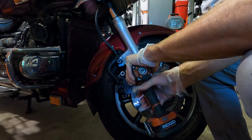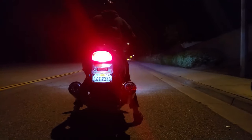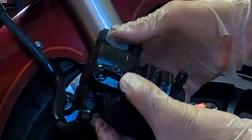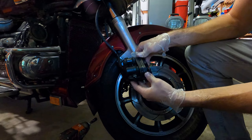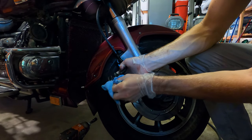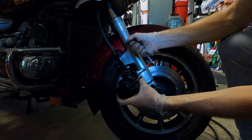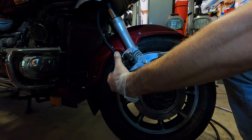I'm curious to see if I'm going to be able to light up the tire like I did on the Blackbird — the Blackbird could just smoke the tires. See if you guys can see that fluid on the bottom of the brakes here — it's coming from the leaky forks, so I just got to make sure I get those. The brake pads are literally wet, that's why this thing was just not stopping well, and when your bike weighs 900 pounds you need it to stop well.